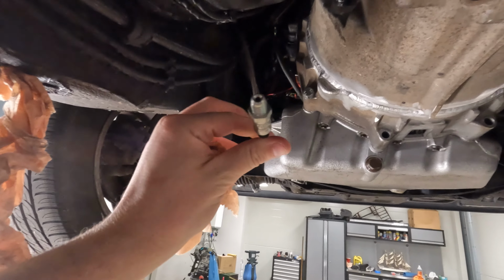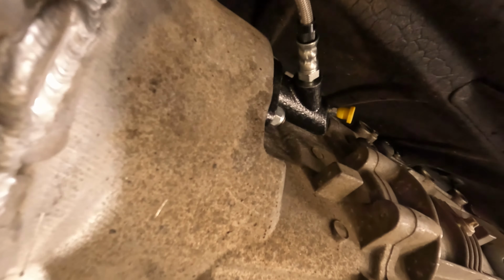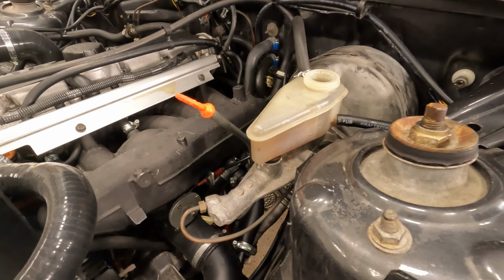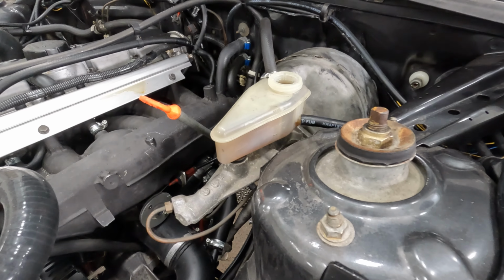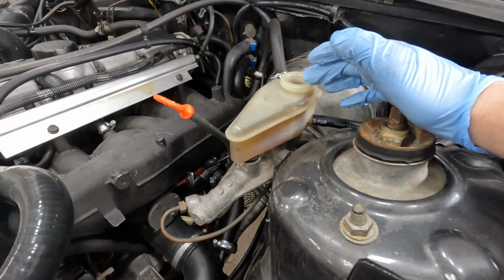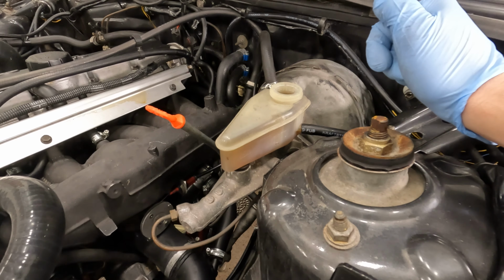And here is the new hose, and it's supposed to go on here on the slave cylinder. Okay, so everything is in place now. We need to bleed the system from air, so we'll start the process now. And to do that, we need to fill up this reservoir to the top. And you probably have to be 2 persons on this, so I recommend that.